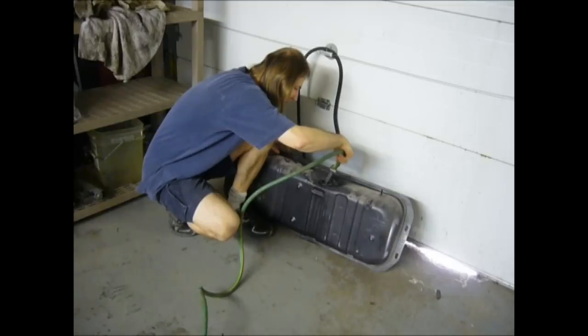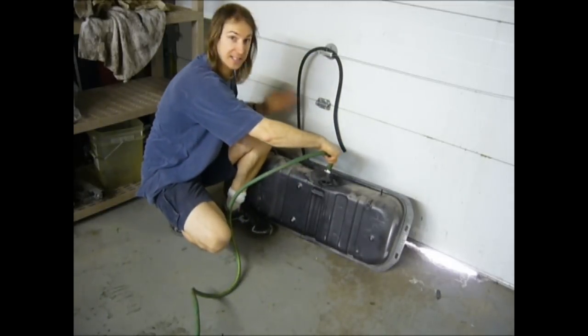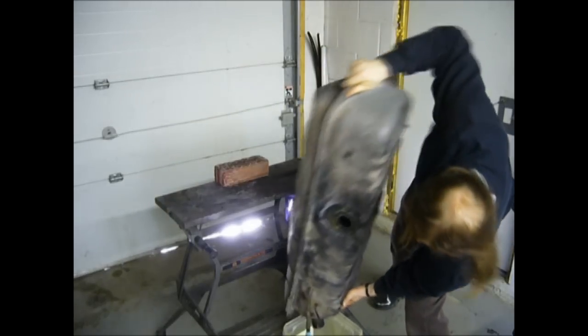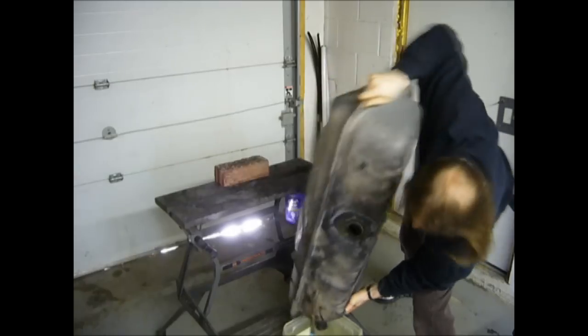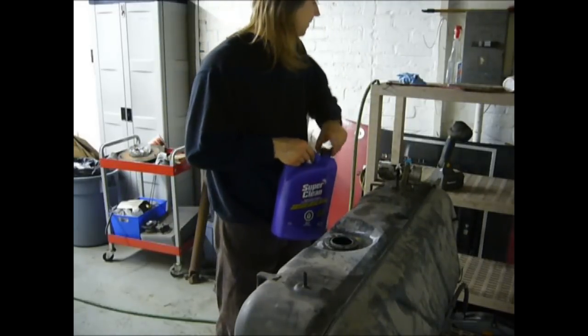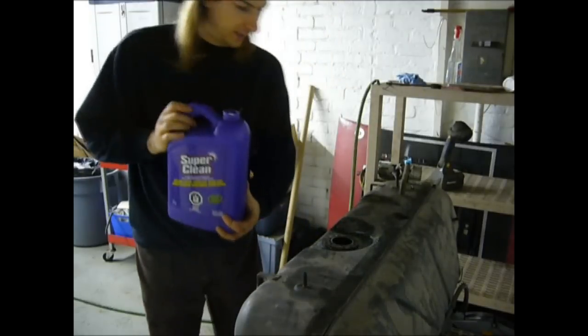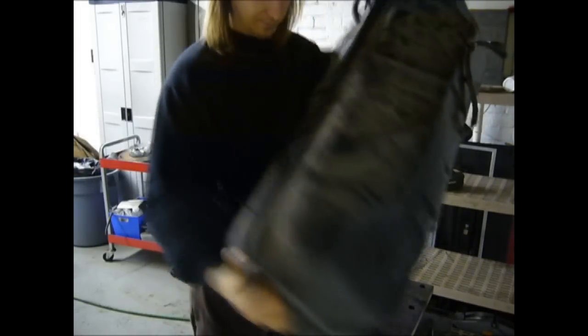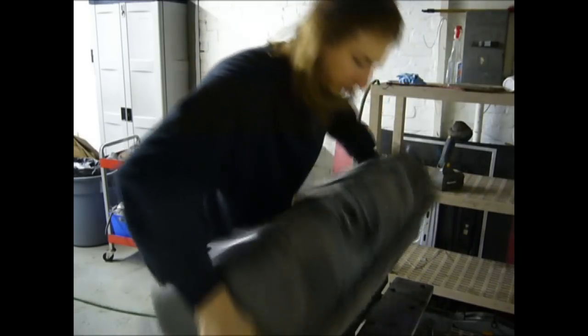So what I'm doing is filling it with warm water and then I'm just going to let it sit for days. God, all the baffles in this thing make it really difficult to empty out — but that's kind of the point. I've flushed the tank a few times now with water and the water is basically running clear, but I can still see there's a film inside the tank, so I'm going to pour the rest of the Super Clean in, swish it around a little, and then just let the stuff sit full strength for a few days. Visiting the tank again, it seems that the pure Super Clean is removing the gunk and crap from the bottom of the tank very effectively.